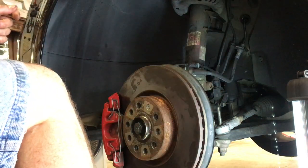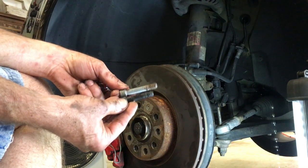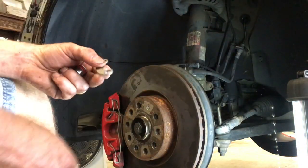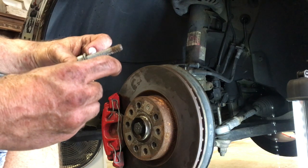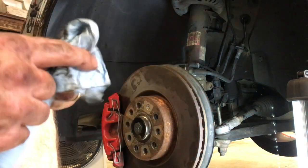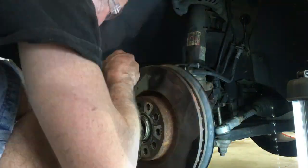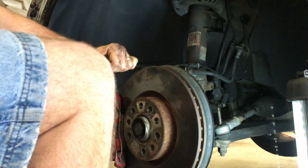Okay, this thing is pretty big. Huge pain in the butt because the old bolts were that much longer than the new bolts. And so it was really hard to get them started straight. So I was trying to use these brackets as well, which came with the old bolts. But then when you do that, you're making even fewer threads that can get into the inner axle hub. So I'm not using those brackets; the new mounting didn't come with those. Anyways, so I'm just going to do without them. Good sign. Went in and bottomed out at least. And now they're all bottomed out.